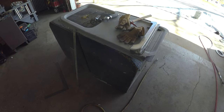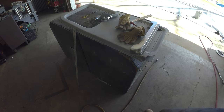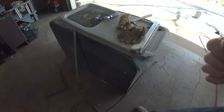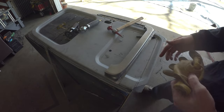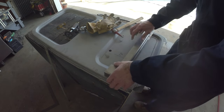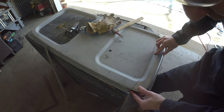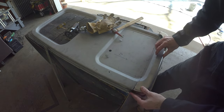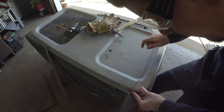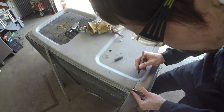They may be intended to be an overweld kind of seam and just deal with the lip versus a true section in patch panel. Let's keep getting him nibbled away. So if I line him up there, could use a bit of a beating with the hammer, but that gives me my 45 to work from.